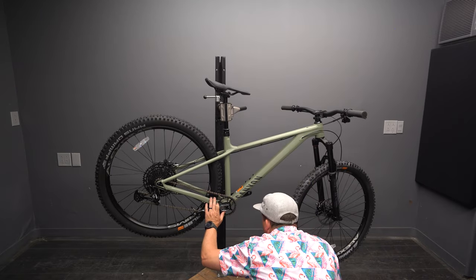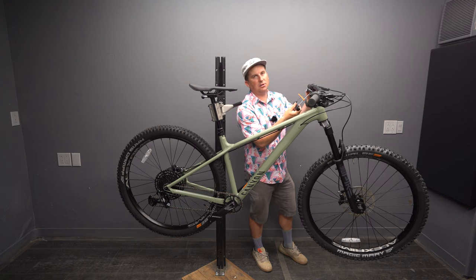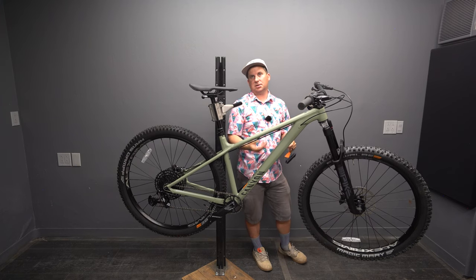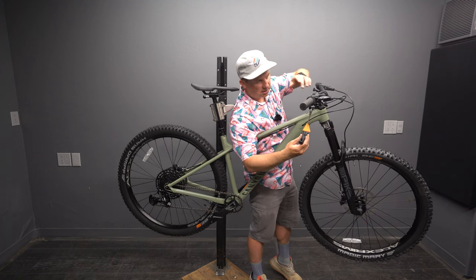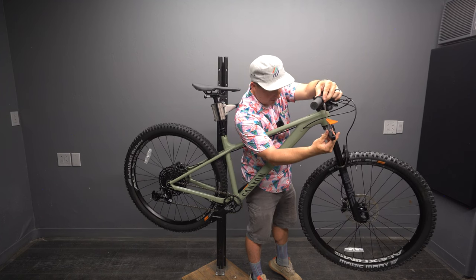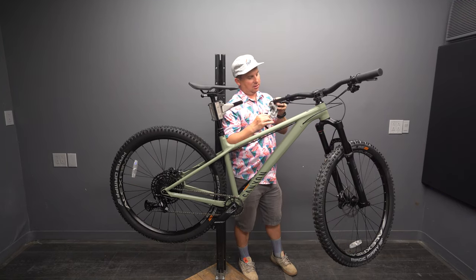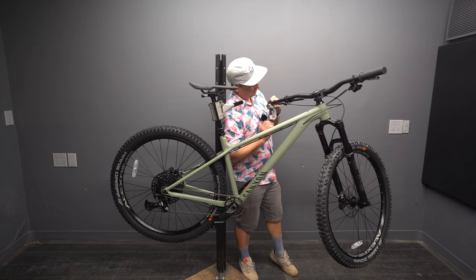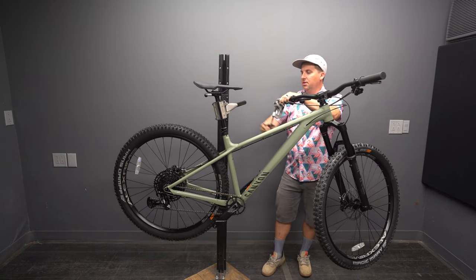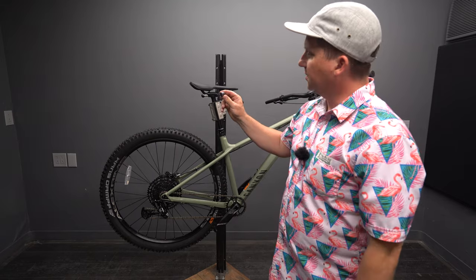These look like long cranks — 170s. Almost every bike comes with 800mm wide bars, which is far too wide for most people. A lot of people tell me they bought a bike and it just doesn't fit them, and when I ask if they've trimmed the bars, they have no idea what I mean. Bikes come with 800mm bars, but they're meant to be cut down to the size of the rider. This comes with 780mm bars and I'm going to trim down to 760 — every review bike I do has 760mm bars to keep it consistent. I just use a pipe cutter; these are aluminum bars, pretty simple. Trimmed off one centimeter off each side.